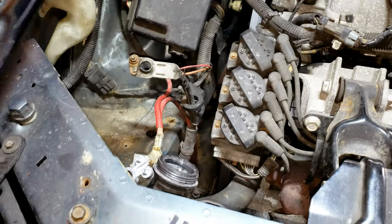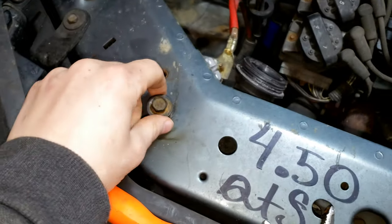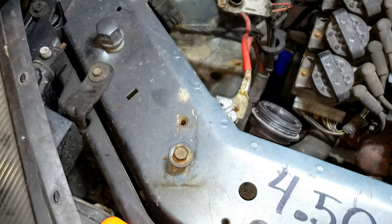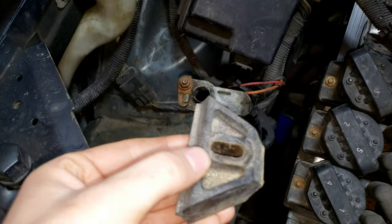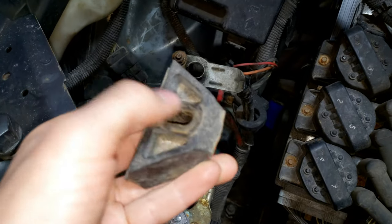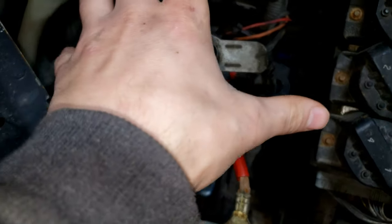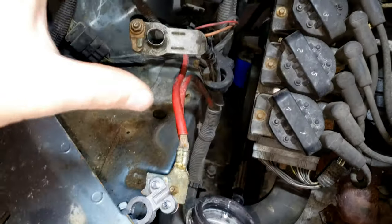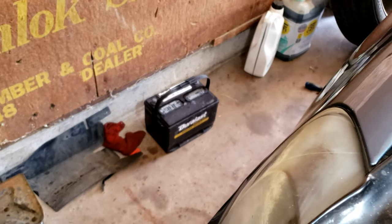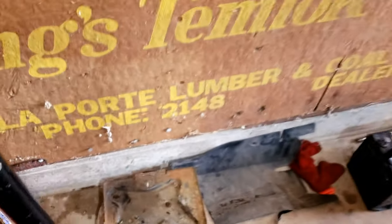Because I like a lot of room, I went ahead and removed the battery. This bracket is a 13 millimeter — this one only had one bolt. Set the bar off to the side. The battery is held in place by this little stopper on the side, it's a 13 millimeter bolt. Come straight out, then angle the battery and you can pull it right up. Twist the battery sideways, put it up, set it on the side. Never touch a battery with your bare hands — battery acid eats really bad.